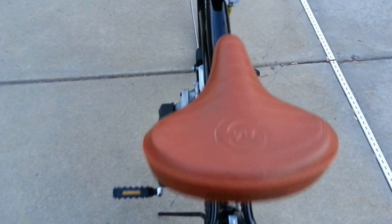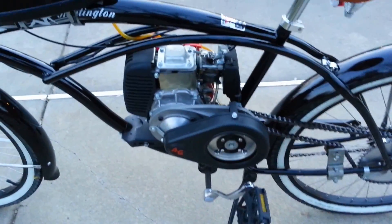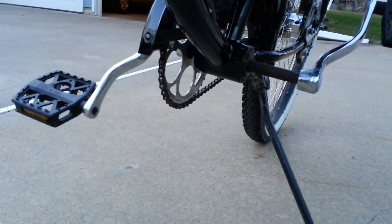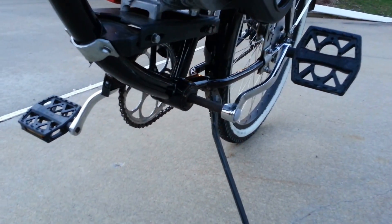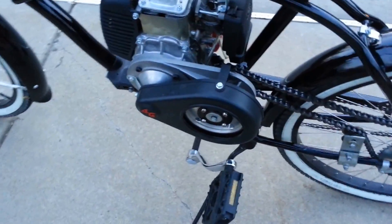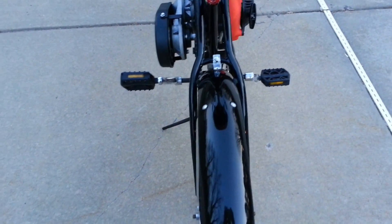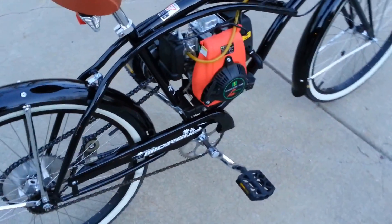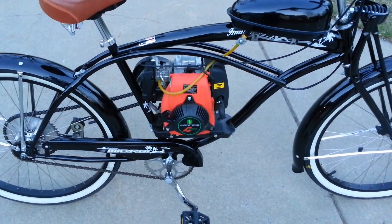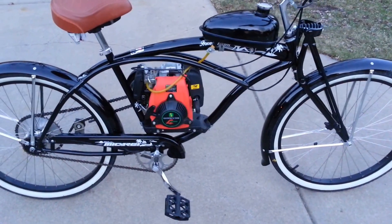One thing you're going to notice about four-strokes — they're going to be a lot bigger than a two-stroke engine. Looking down here, it is going to be pretty wide and take up quite a bit of space in length and height. Because of that, with four-stroke kits you get a widened crank set — you can see how wide the cranks are, and the pedal arms are also molded wider so you can pedal and clear the engine. Because the engines are so big, it's limited to what bikes you can use them on. The most popular are beach cruisers, but you can use other bikes with a large frame — on a V-frame like a mountain bike or road bike, you'd want around a 21 to 23 inch frame to fit the four-stroke.